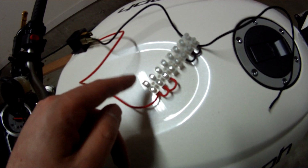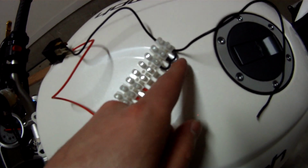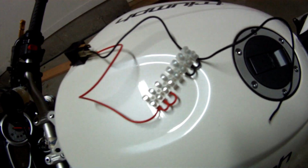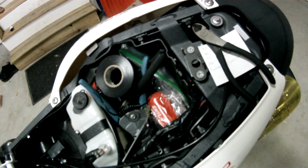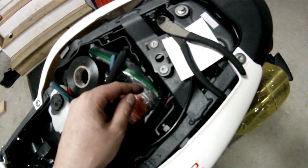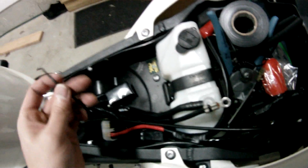One will be for the grips, the second one can be for GPS or something like that. Same thing with the negative. I have 2 that can go out for negative. Here, I tapped into the yellow wire that's going to the brake light. That's the ignition wire, 12-volt wire. I put a little tap on it, ran wire, and wrapped electrical tape, and here's the wire coming down, and here it is here.